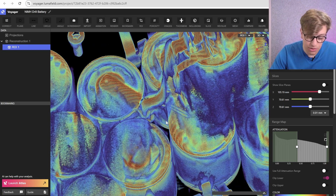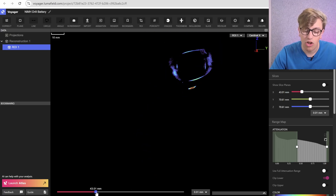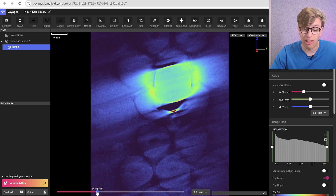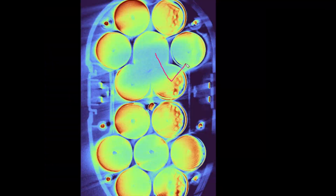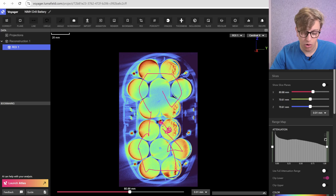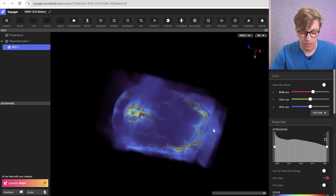It's going down into the pocket in the middle — why there? Well, that's a pretty good spot to put a thermal device in, just the most shielded, hottest spot in the entire battery pack, just to ensure it reflects how hot the device is getting. There's even a little plastic tab molded into the case that the thermal protection can be attached to. All these cells are chained directly in series, and other than that, there are no electronics in this entire pack — just a thermistor, and that's it.